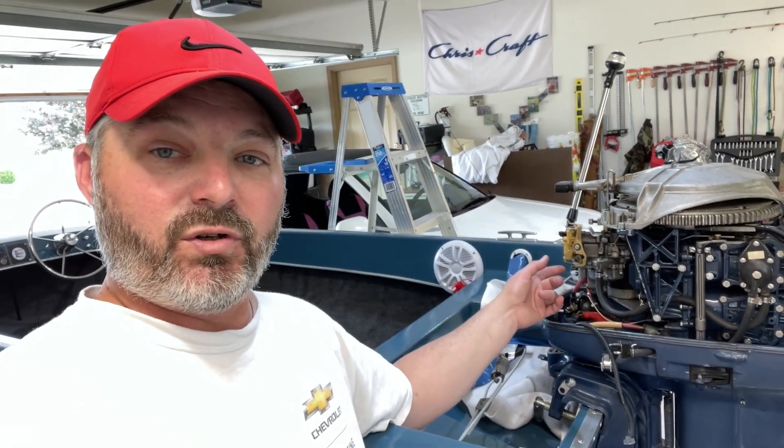Fingers crossed. I'll show you how the main engine harness plug goes back together — pretty simple. Then we'll get the two wires for the starter hooked up and we'll start testing out all of the electrical stuff that is done on this boat. I've got lights to show you — the all-around light, the front nav lights, the stereo, the underwater lights, a horn and air horn, and cockpit lights. Let's check the starter first.